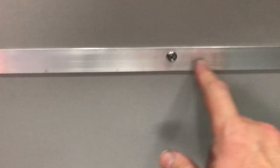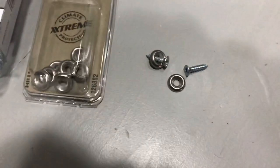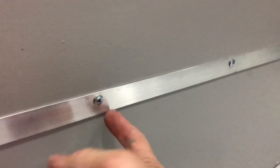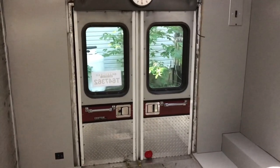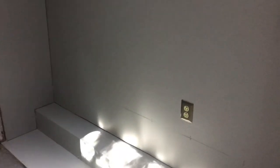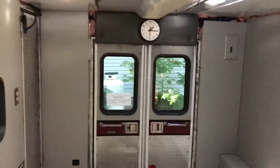Here's a neat little strip — this is where that seam came together. I got a very thin piece of aluminum and put in these neat little screws: just a wood screw with a little washer through a finish washer, screwed to the top board, with the lower board overlapped and tucked up under there. I absolutely love the paint. I went ahead and painted the boxes even though they'll be carpeted — I had the extra paint and wanted to seal it up. You can still see this seam down here, but that's where the bed's going to flip up, so I'll just leave that alone. It's looking wonderful.